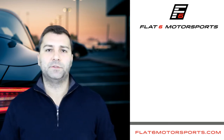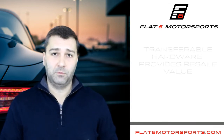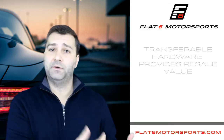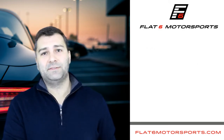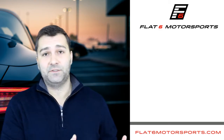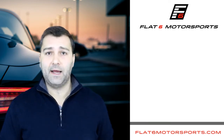Piggybacks are traditionally a little bit lower cost, so a little cheaper. Another benefit is if you ever do want to remove it, you can sell it to somebody else and they can plug it right into their vehicle, whereas flash tuning typically will marry to your ECU or lock to the VIN. The resale piece of flash tuning is very challenging because you have to either unmarry it, or in some cases you just can't sell it to anybody, so you'll never get any value back out of that.